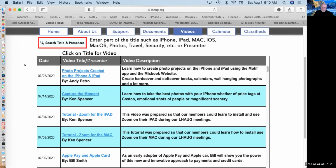But the other thing that came up was, how do we do a bigger reset? First of all, if your computer is totally locked up and you can't do anything with it, you can do the unceremonious total shutdown by pressing and holding the power button. It only needs about 5 seconds, but I always tell everybody 10 seconds because everybody cheats. Don't do it just when the screen goes dark. You want to continue holding it and then start it like normal.